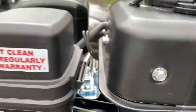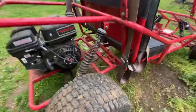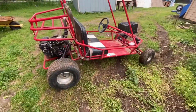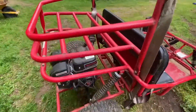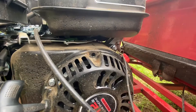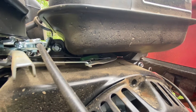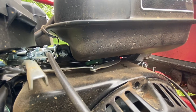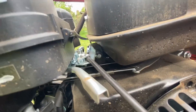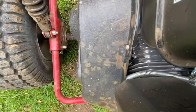I'll let you know how it goes. Alright, here it is. As you can see, we've been ripping it around for the last couple of days testing out the modifications — the zip-tie governor bypass and spring install. I removed the gas tank when I showed you, that way it would make it easier, but I think you could probably do this if you're skilled with a set of needle nose pliers. If you can see under there, the zip-tie goes on top of the shorter linkage and under the longer one. That keeps that spring nice and compressed. And then right here on the other side of that throttle linkage is that spring — it goes right from there and connects down to the fan shroud bolt.